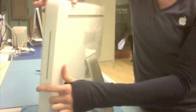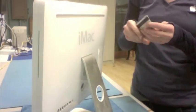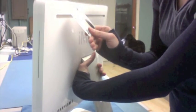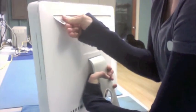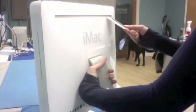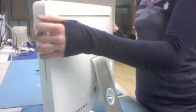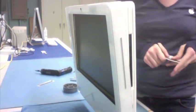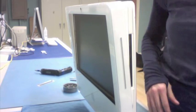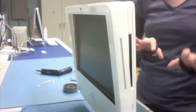It's actually right on the underneath of this front bezel, and the rear bezel clips into it. We need to blindly loosen up those clips. So the way I do it is I take my card and I stick it in at an angle. That released right there — you know that it released because the end will actually pop forward. And now I go to the other side, and again I go in at an angle. That popped right open as well. Now, that does not always pop open that easily, and that's okay. Don't get frustrated with yourself. That right there is the most frustrating part of this entire process. So once you get that done, it should hopefully be smooth sailing from there.